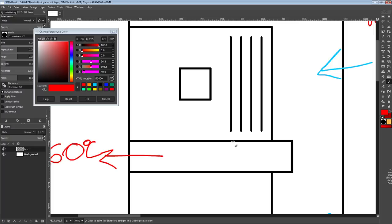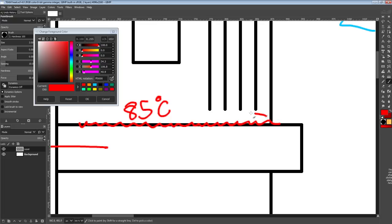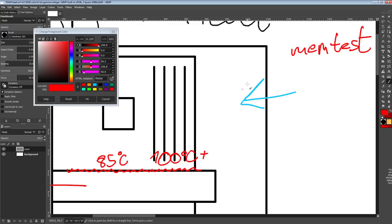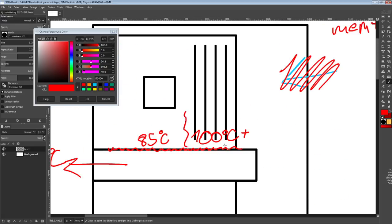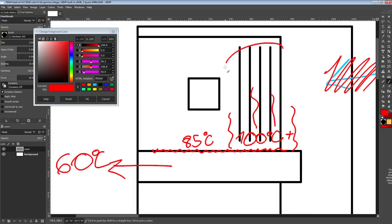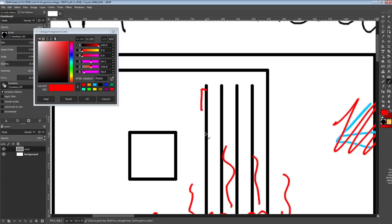With blower cards, sure, your hot air gets kicked out the rear, but that doesn't stop the PCB itself from getting very, very hot. Right behind the core, your GPU's PCB can easily be 85 degrees Celsius. Memory chips on the GPU can also go into the 90-degree range. The back of the card can be absolutely scorching hot, and the VRM area can easily be 100 degrees plus. If you remove the intake fan and only have direct airflow over part of the case, you're now going to have heat rising off the back of the card that can cook the lower half of your memory sticks — and any single hot memory chip can make the whole stick unstable.